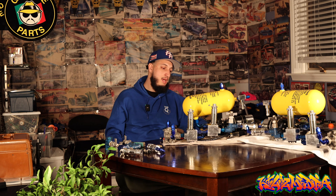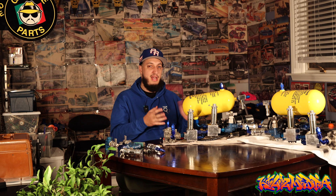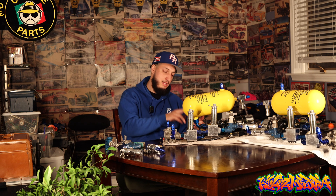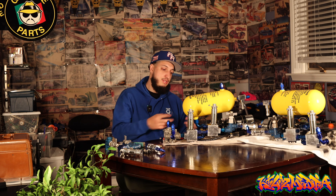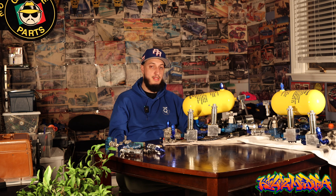The Pesco motor spins a gear inside and pulls fluid out, sending fluid in. This is a Pesco triple seven — they call them triple sevens because the part number designates '1E777.' You can run different pump heads. There are also your 280s, your 301s, tons of different ones. You also have triple sevens that are shotguns, and your roosters. 'Pesco' is just a layman term — there are many other options like your MCOs, Westinghouse, and Adels.